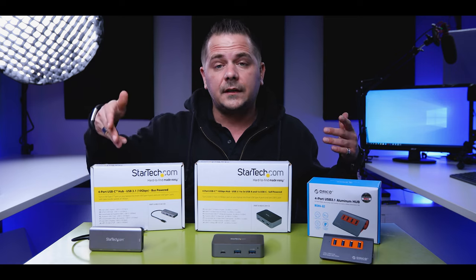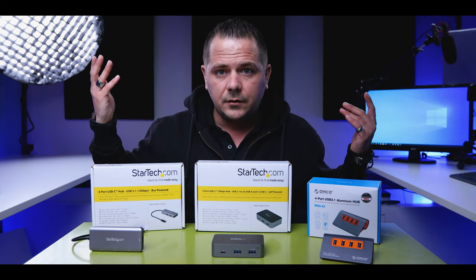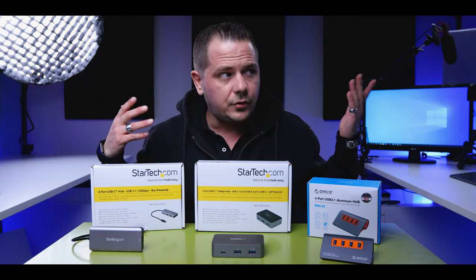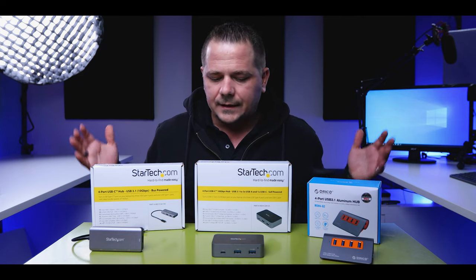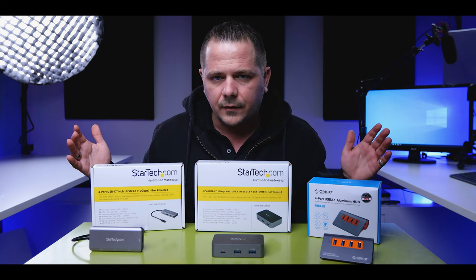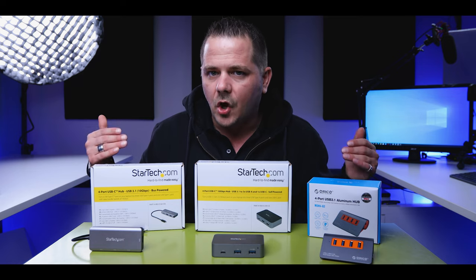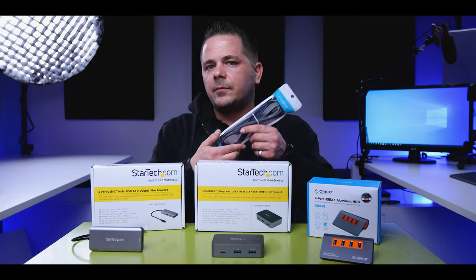One last thing — how are you going to connect everything? The idea is you buy this hub so you don't have to buy long cables. You can have one long cable and connect it. But you need to make sure you're buying the right cables. I've seen people do reviews and they don't even have the right cables, and they're like, oh, this doesn't work. You need a USB 3.1 Gen 2 cable. You need to use that kind of cable to get the speed. If you're not using a rated cable, it's not high quality enough to get the data through.